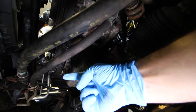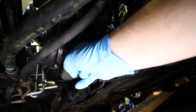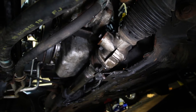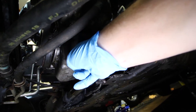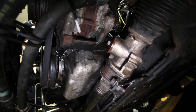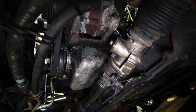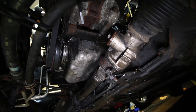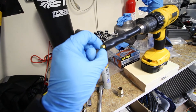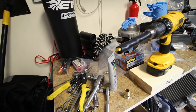This is the oil pan and this is facing front. You're going to want to first mark your hole two inches down from where the pan meets the bottom of the engine block, and then go as far back as you can — right below the AC compressor if you have it. So two inches down and as far right as you can. It'll also help to zip tie the AC lines out of the way to get a clean drill. Keep the drill as parallel to the ground as possible. Before you drill, put some grease on the flutes of the bit to catch all the metal shavings, and periodically take the bit out and clean off the shavings and reapply the grease.